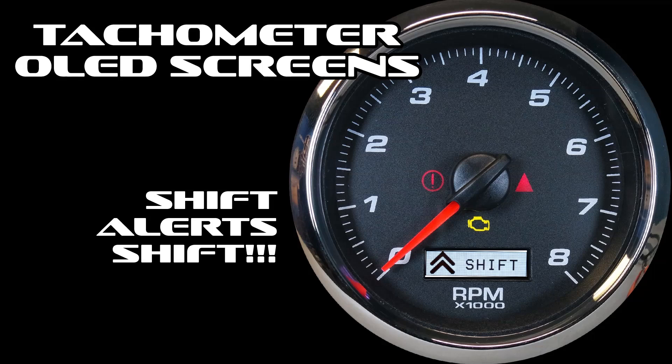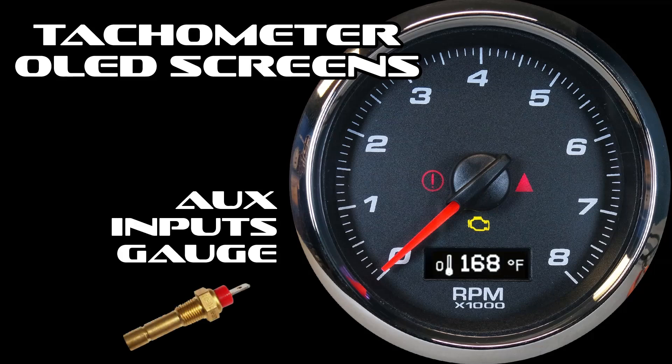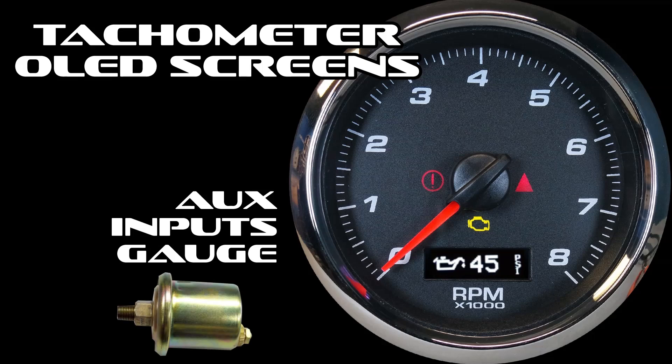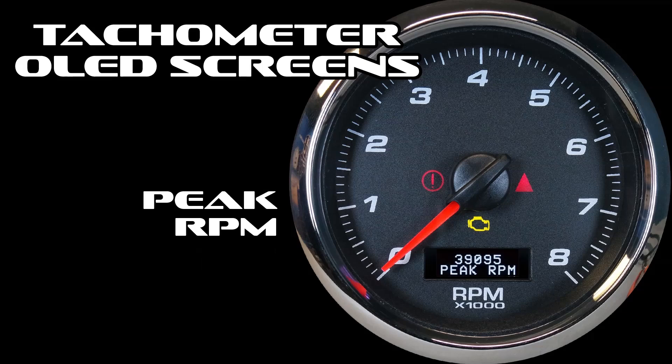Super clean, super easy to use. Our hour meter is a carryover from our military and marine customers who are dependent on hours versus miles to determine service. On the tachometer, voltage is read internally so we don't need to use that wire, and we feature two auxiliary inputs — just as on our speedometers, you can display a gauge or warning icon using a sender or ground signal, all without any additional drivers, modules, or boxes. So you can actually have three auxiliary inputs or indicators on the screens — a six-gauge kit can really be nine without any extra boxes. Peak RPM is a nice fully resettable feature to check your peak RPM, kind of like a modern telltale.